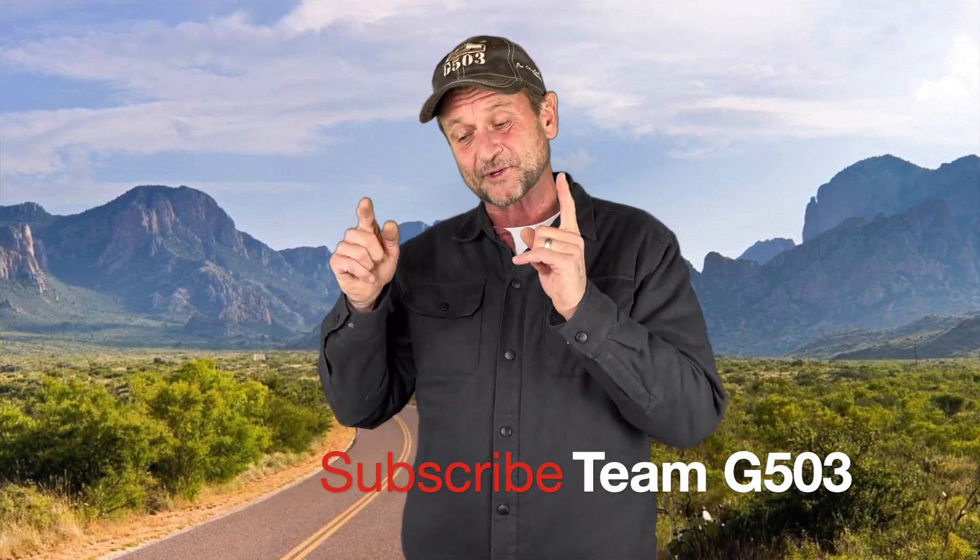Must have done it right because it works. The system is not that complex — in fact it's very basic. Most of the time if your fuel gauge is not working correctly, it's because it's not grounded properly, as I showed you in the video. Hope this video helped you out. Hope maybe you can go out to your Jeep now, take a look, and get that thing working. It's kind of crucial to know how much fuel you have — you're out there on the trail and all of a sudden you run out of gas. I've been there a couple of times myself. If you'd like to subscribe, click that subscribe button and click that little bell so you'll get a notification when we release new videos. Until next time, my friends, keep it safe and happy Jeepin'.